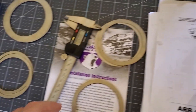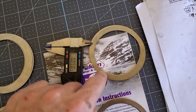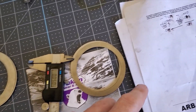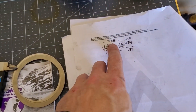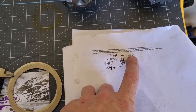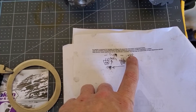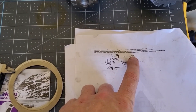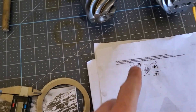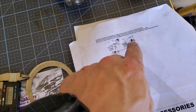I went ahead and set my caliper up with the new shim pack, and I got 50 thousandths on it. 50 thousandths is going to give me relatively close to what I'm looking for. The stock one was at 40 thousandths — they didn't get down to the one-thousandths place, they went to the ten-thousandths place. I feel like 49 and 50 are close enough — that's what I'm going to run. We'll put 50 in there.